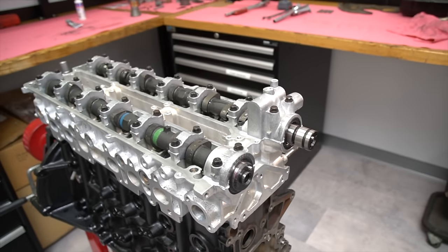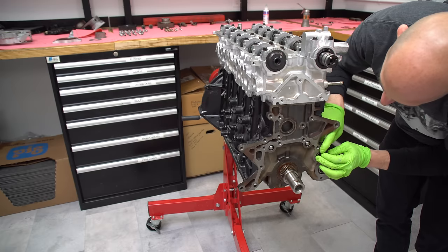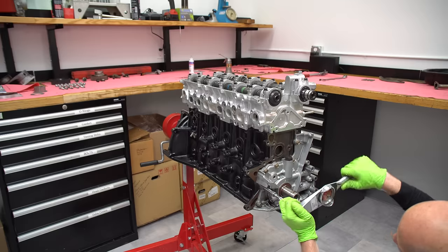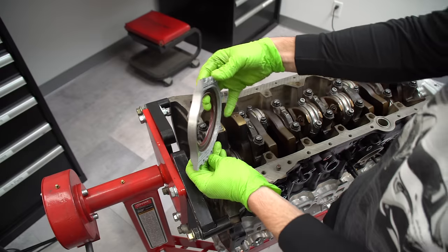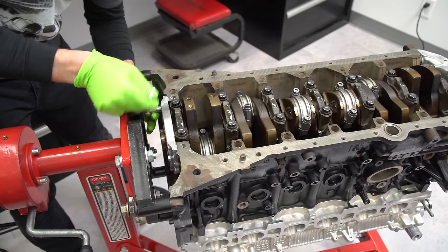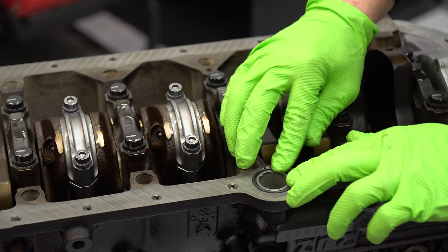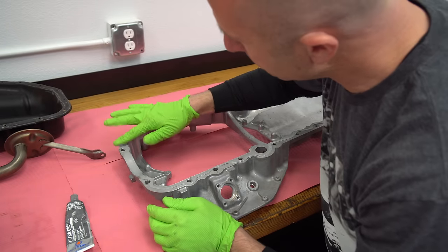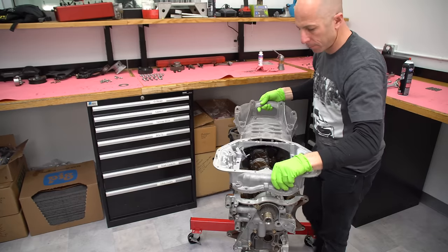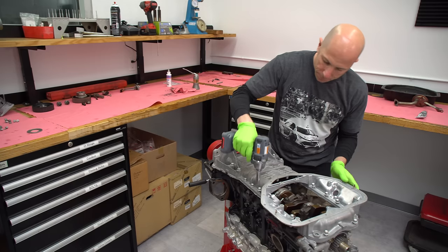Next we're gonna put the oil pump on — there's just some silicone and a couple of O-rings. I've already changed the front main seal. This is our new rear main seal — there's some silicone on that as well. I'll have to reach in, which is kind of a pain, and get these six bolts. Next we're gonna put on the upper oil pan. This one's really cool because it ties in the whole block and it's actually a bit of a stiffener for it as well. There are no gaskets here, just silicone. Put the silicone in, zap in all the bolts, and torque it down to Toyota's recommendation.